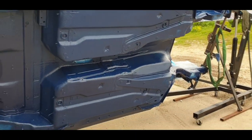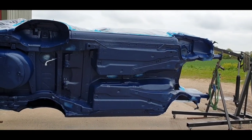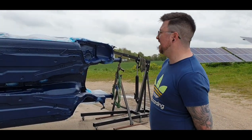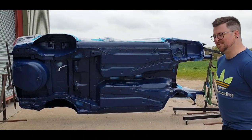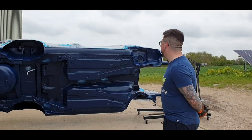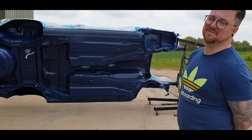I think probably the hardest job was, because with each can you're trying to mix up an exact amount in bottles that are black. Now if they gave you a clear bottle where you could actually see where you're filling up to, but you are literally eyeballing it each time. And we actually used 4 cans of Raptor first, but our supplier could only do Cobra. And you actually said it was a better system for mixing, didn't you? Cobra was printed in metric, so the Raptor was 8 ounces of the hardener, and then however many ounces of the actual Raptor, and I don't know what ounces are. I'm millilitres and litres. There you go, exactly. So our problem was just trying to measure it out to get it even. Sometimes it might come a bit lighter on one coat and another coat a bit darker, but as you can see, well, that was our poor preparation. We didn't buy any mixing cups.